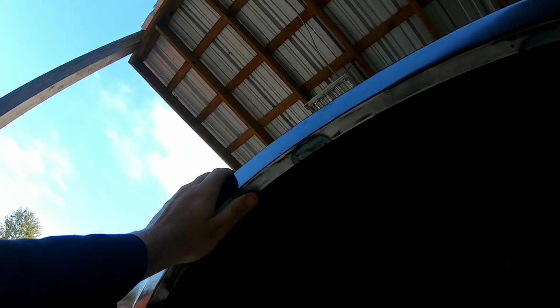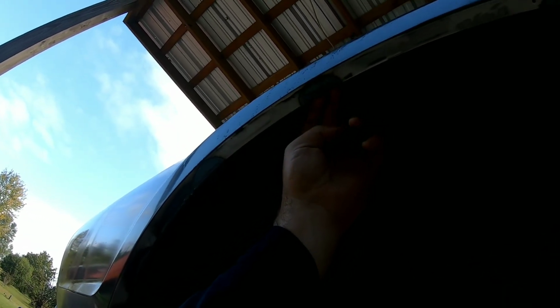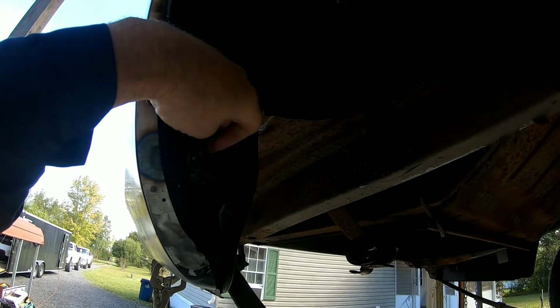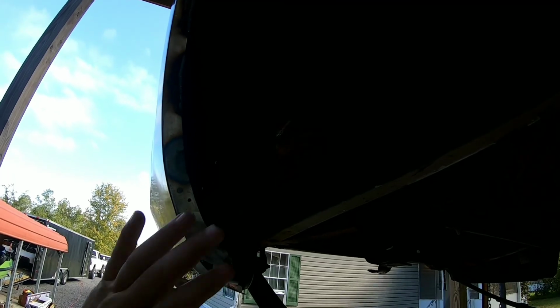And then we got the outer wheelhouse, wheel well, welded to the quarter. Some places I could come in from the top and get a good weld and it keeps it nice and clean. In some places, the way that it lipped over, I had to weld it right on the edge, so we'll just come back and knock that down, make it nice and smooth. But like right here is good. But you see that the trunk extension here matches the inner wheel well, or I guess that may still be the outer wheel well, but if we wanted to close the gap in the back, then it would have fell short here on the actual wheel well itself. So it seemed easier to patch the back rather than the front.